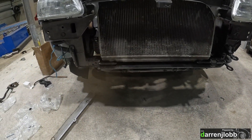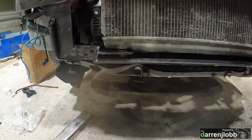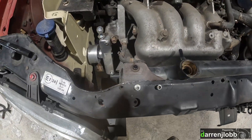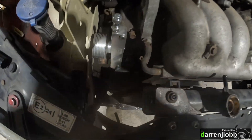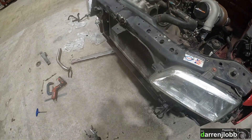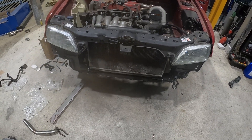I've got that cross member finished off and splashed some paint on it. You can see I've got the stock radiator sat down in those rubbers at the bottom and we've just made up those two brackets at the top which holds the radiator in nicely. That's actually the factory rad hose on the top. We've got clearance down the bottom for the alternator - not a lot, but enough. We've just sectioned a piece out the front of that back cross member for the lower rad hose. It's sitting in there quite nicely with loads of room for fans on this side, or potentially the other side once we've got the intercooler and oil cooler in there as well.